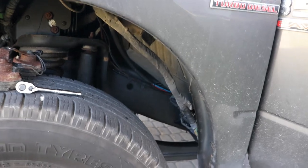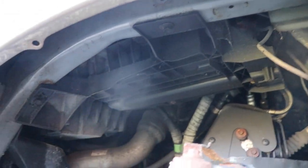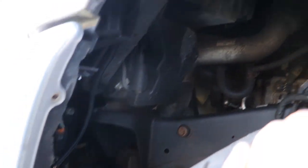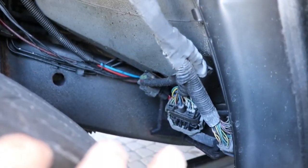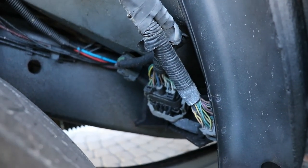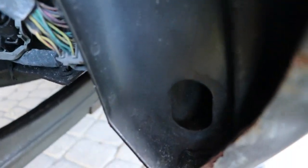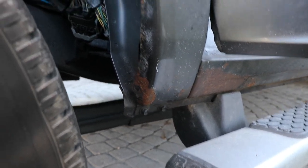To do this job you do need to take the fender liner out, which is a whole video on its own. While you're in here you should take a look around — your main wiring harness is right here, so you want to make sure that it's not damaged. You can also look inside your rockers and see that they're clean, and if they need to be oiled now is a good time.